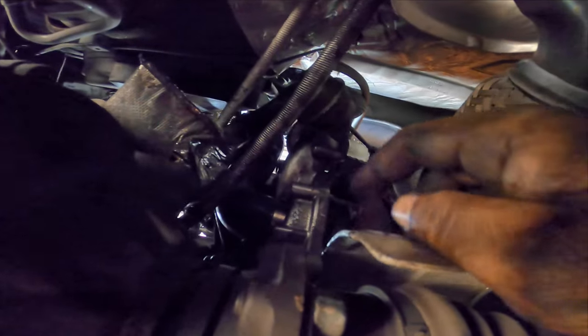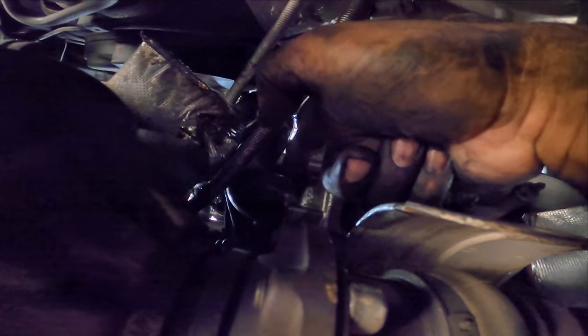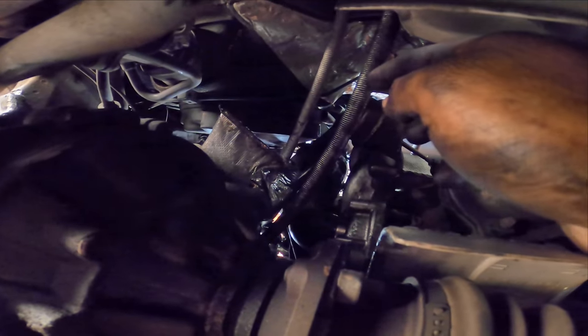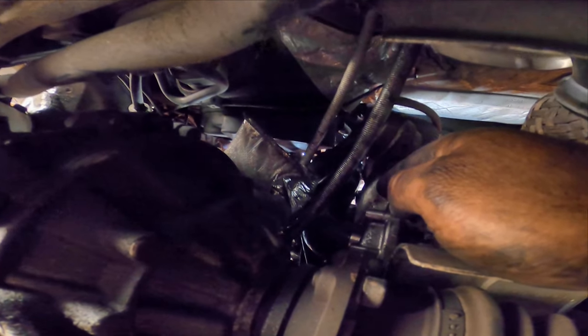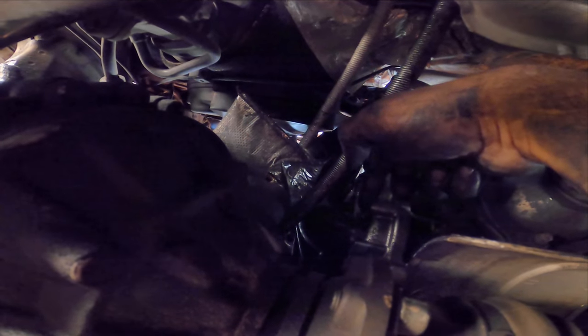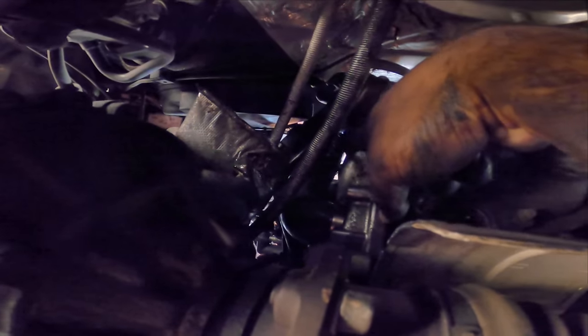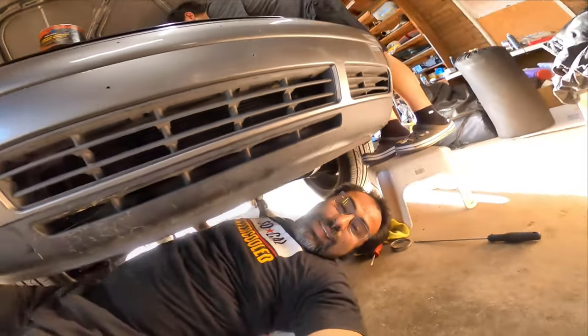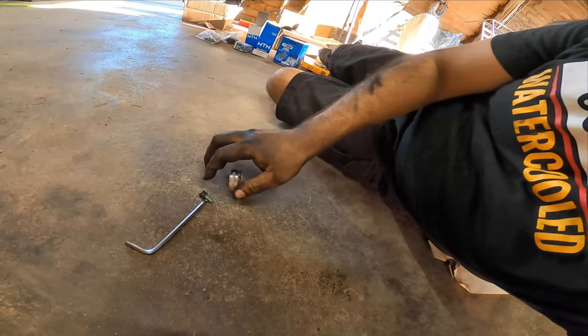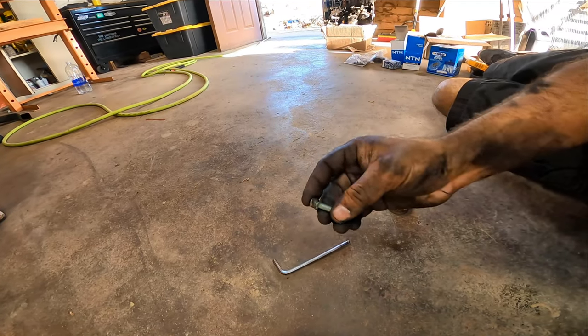As I explained earlier, we had to fold it, slide it in, and then while he's pushing down you're wiggling it in — trying to with your finger slide the inlet pipe into the turbo from down below, and then that's it. Open up your clamp all the way, slide it around — don't try to slide it on, wrap it around — then tighten it by hand. Use a really long flathead screwdriver for your clamp if you have that style. You can see the edge right here; sorry for the lighting, it's underneath the car. Then clamp, and all he has to do is run the last vacuum line that's on the turbo in the pipe and we're done. You can see that's the five millimeter bolt right here that holds the factory turbo inlet pipe in place.